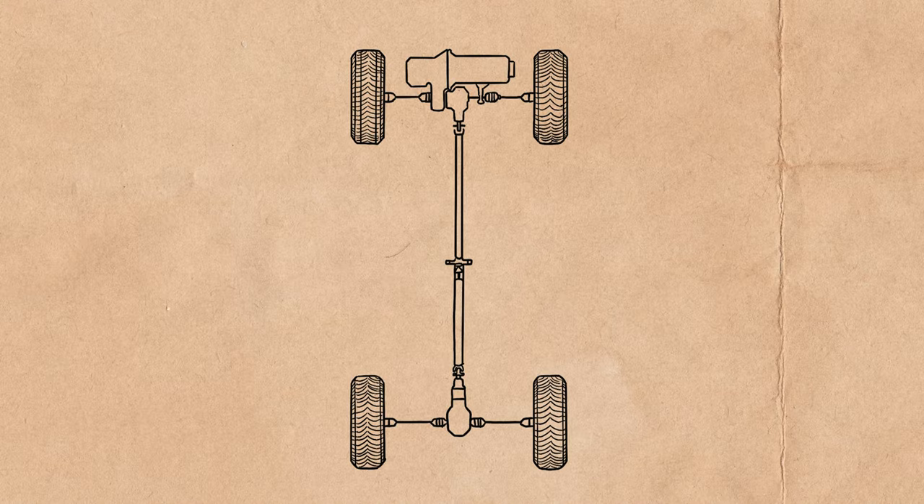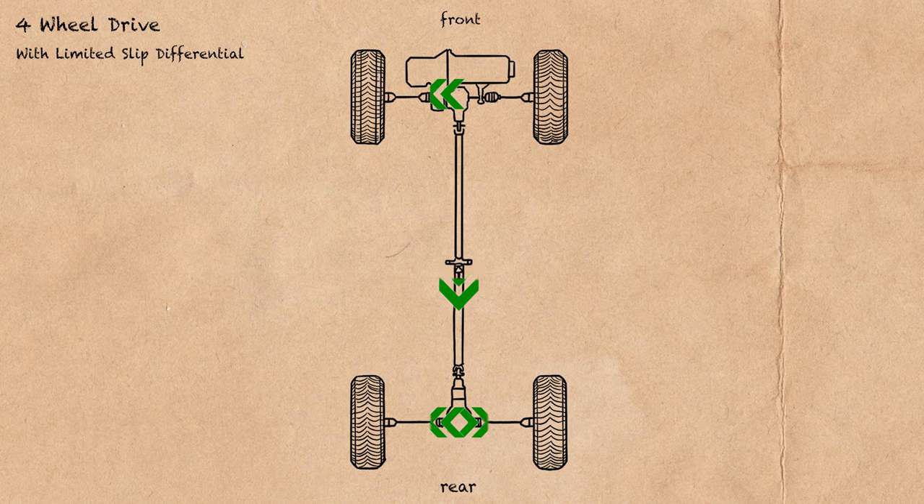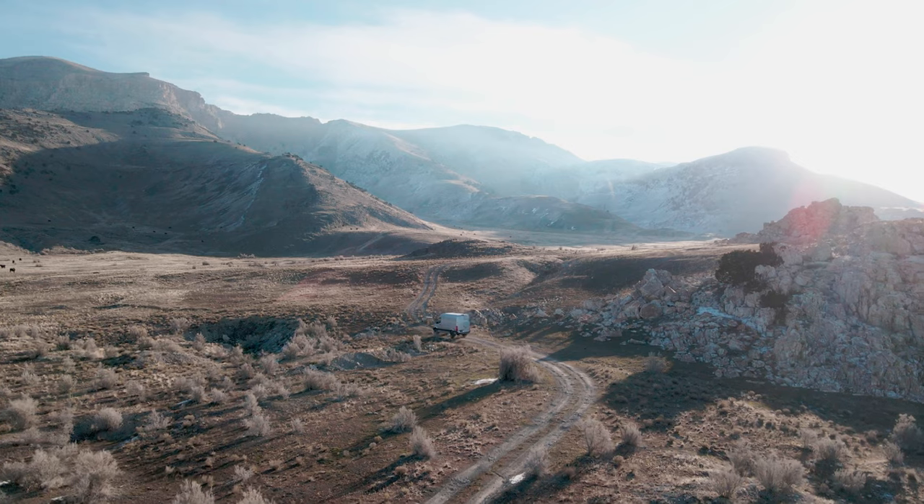And so to add the limited slip — that now makes you have a three-wheel drive van. Both of your rear wheels are driving and one of your front wheels. It's useful in sand conditions, snow conditions, rain conditions, mud, rocky terrain, anywhere where there's limited traction available.